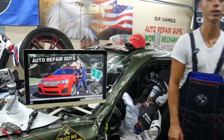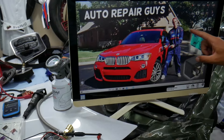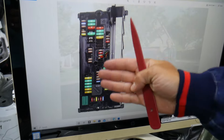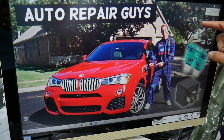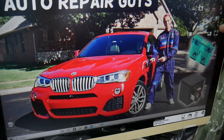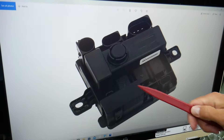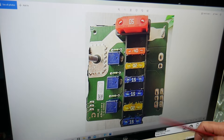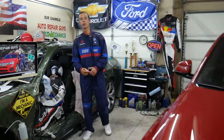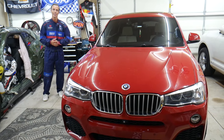One of those will cover the throttle body and throttle position sensor, so if you have problems, check these fuses and relays. If you don't have relays, that function is controlled by the engine computer. If you need to buy parts, tools, fuses, or relays for your BMW at a good price with quick shipping, we'll put a link in the description below — especially for these specific little fuse boxes that can be really hard to find. Hopefully this video was helpful — if you have any questions let us know, thanks for watching, and see you next time.